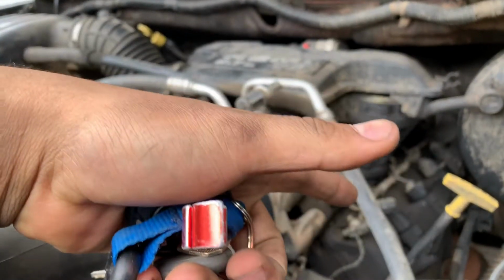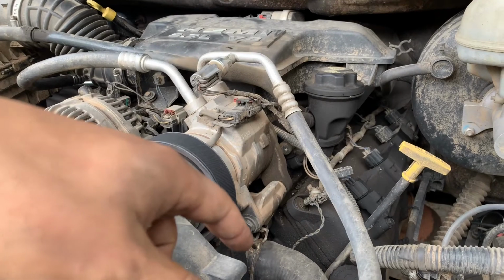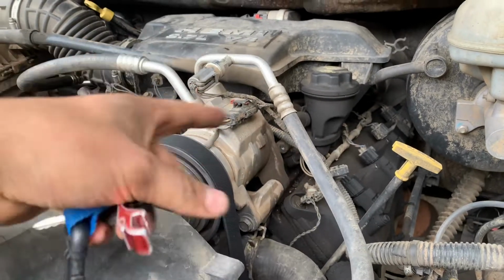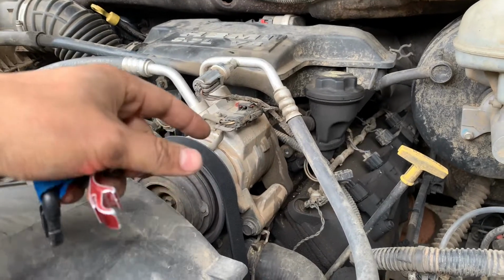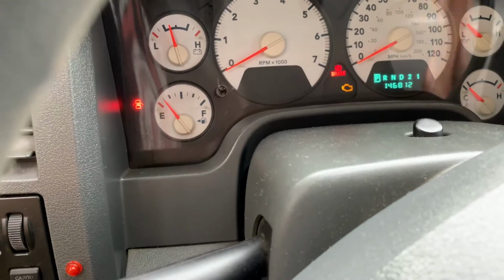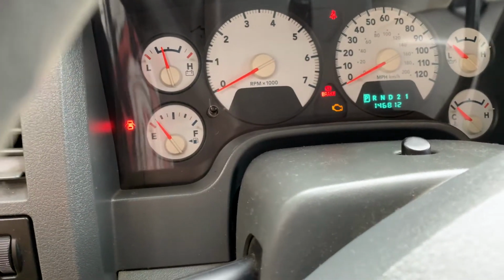I'm not gonna record this side because the camera gets in the way, and it's just harder to record. So I'm just gonna finish this side up. But overall, that should do it. So if the misfire persists, it's probably a bad lifter. That was the other suggestion that the diagnostic test gave.